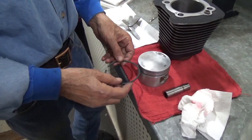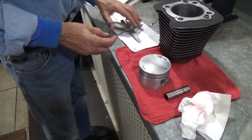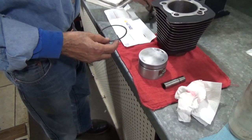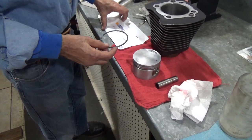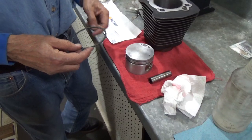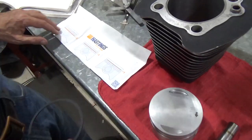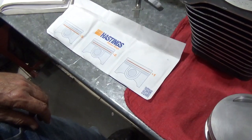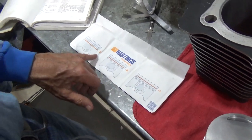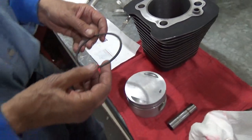That's real good. After this ring is on the piston I'll probably check it again. This is the top ring. Every time you pull a ring out of the package to check it, you want to be sure you put it back into the package before you take the next ring out, to make sure you never mix them up. Top ring, second ring - these all go according to plan. As you can see on the package, they're marked one, two, and three: top ring, middle ring, and bottom rings.